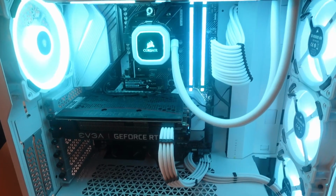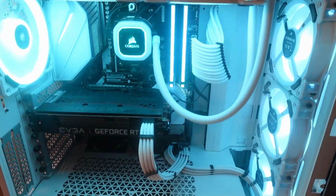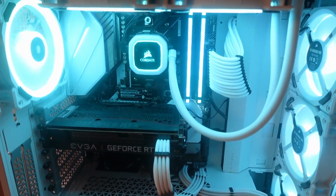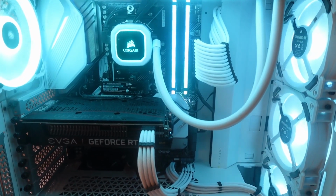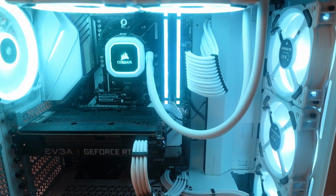So, yeah, that's a little strange, but hey, I went ahead and reset the BIOS. That was the first thing. It did come up after that. It came up that it was being flaky, so I took one stick of RAM out. It came up easily. I went ahead and swapped out both sticks, and it came up really easily. It came up very quickly.